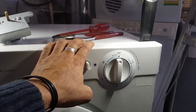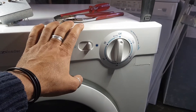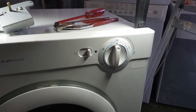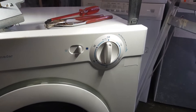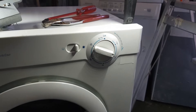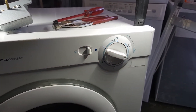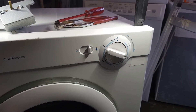What are some signs that you need a new timer? With this particular machine here, what's happening is it gets to around here and then within two minutes it skips half an hour — it's almost done. So this timer needs to be replaced. The most common problem I've noticed is that the timer will tick along, get to one point, and then just stop. But the machine will still keep going — it's still drying your clothes — but the timer no longer works and the machine will just keep going forever, so you need a new timer.